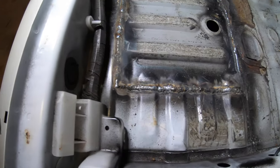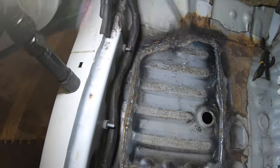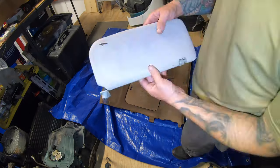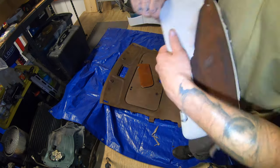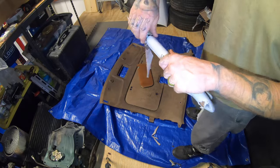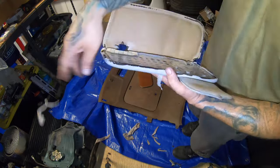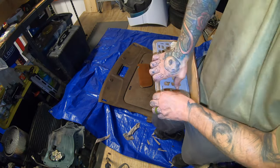Now it's fully welded in place. I applied fresh seam sealer to the back side and paint on both sides, then time to sand it. I pulled the headliner out and you can see how incredibly flimsy the material was — it's just shredded and ripping right off of this visor. It was the same for the entire headliner. Now these visors are two-piece, they just kind of open up. The fabric is folded around the edges and the vanity mirror clips in place — pull that off.